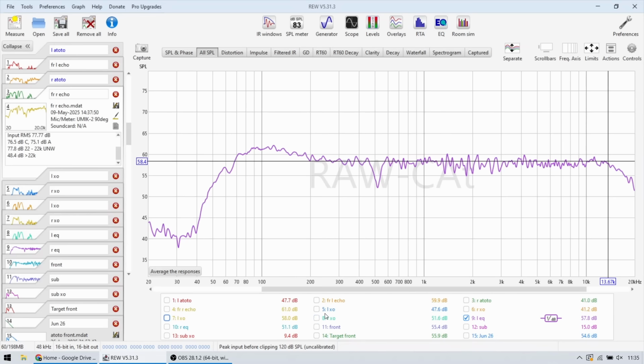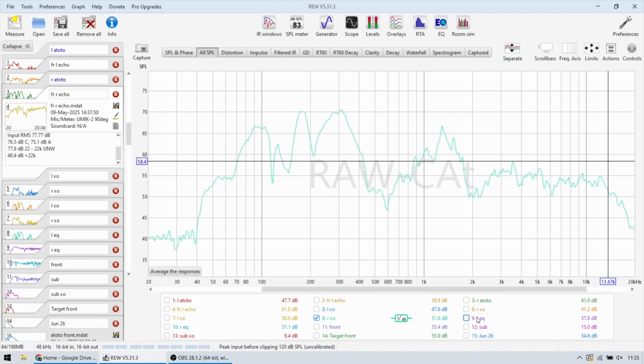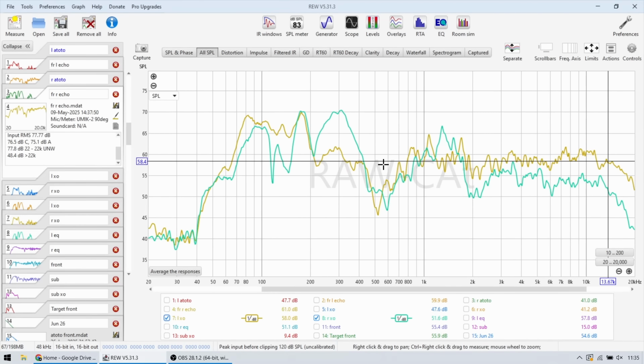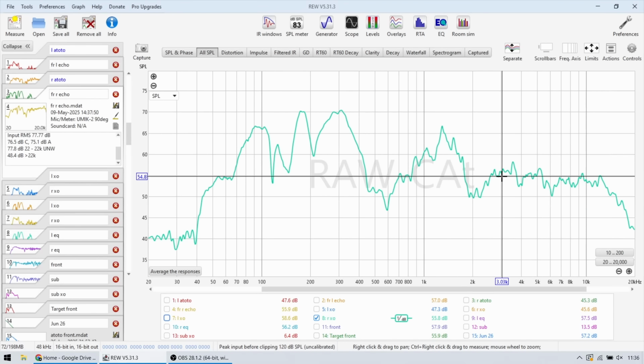However, the right side, we started with this. So even if we're starting left and right, you can see they're kind of on the same level. However, the right side, the driver's side, has lower tweeter level. So instead of boosting all the tweeter level, because it would need quite a lot of boost, I had to cut all of this down.